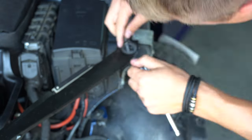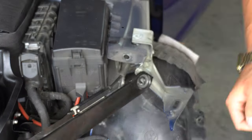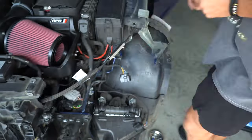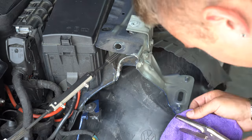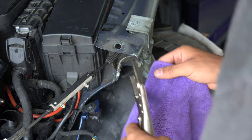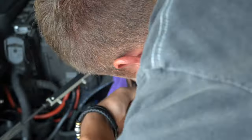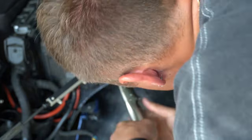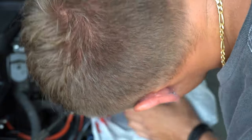The first thing I needed to do to straighten out the support arm was remove the upper support bracket from being in the way — it's only held on by three bolts, so it was easy to remove. With that off the car, it was time to straighten out the metal. I bought some needle-nose vice grips at Harbor Freight for this exact reason — I had a feeling I would need to bend metal at some point on this car. Using the vice grips with a rag, I was able to easily bend the metal back into shape without scraping off much of the protective primer, which prevents against rust. For any spots that I did get nicked, I used some automotive primer to cover it up quick.